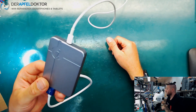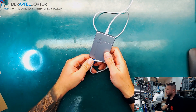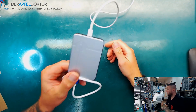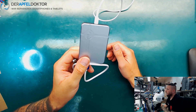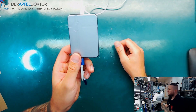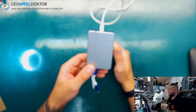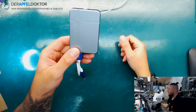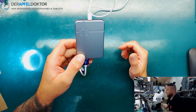As I heard first of these boxes, I want to be honest — I said oh no, it won't work, it's based on a jailbreak, it's based on the checkmate exploit. And I can take the NAND out in about two or three minutes, it's not a problem at all. But now after using this box and seeing that it really works — great, fast and easy — it just saves a lot of time. Because I can just swap the Wi-Fi module and after that use the box, or if I have corrupted NAND I can just rewrite the data without even opening the phone, and that's a real big advantage. You have one software, one PC, just a cable to plug in, and it works. So I can recommend this tool 100%. You can get it at unionrepair.com if you want to order — and there you can get the P10.